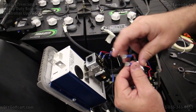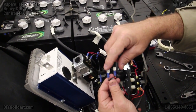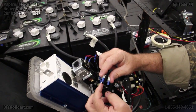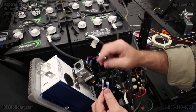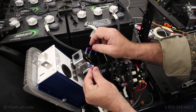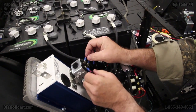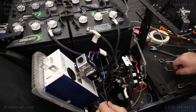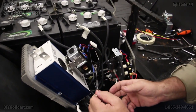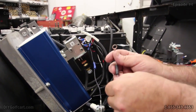Now on the other side, I've taken the diode and removed the ring terminals and put female ends on it. I'll need to put it on matching up both red and black to red and black. The ring on the diode goes towards the positive — we've already determined this red is the positive, so we'll just go ahead and slide it on. Now all I've got to do is put my 250-ohm resistor going across the two large terminals and hook our cables back up. Then we'll be able to jump right over to the controller.